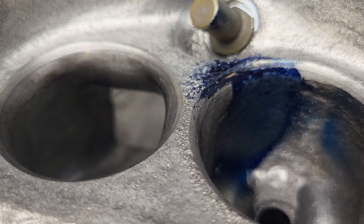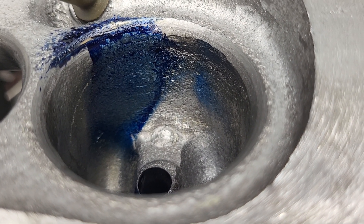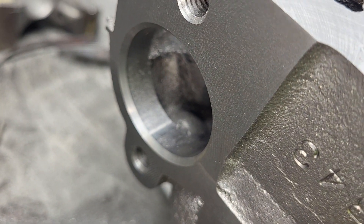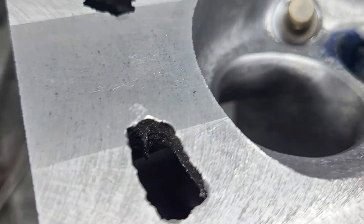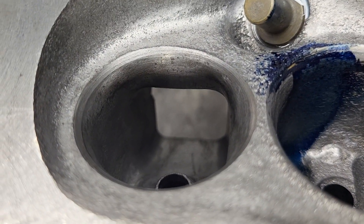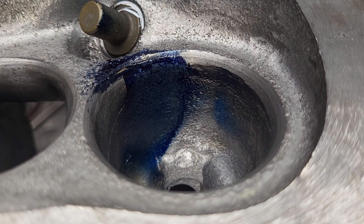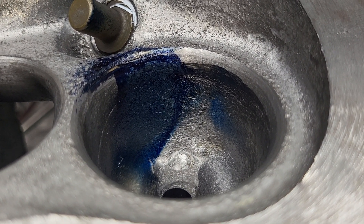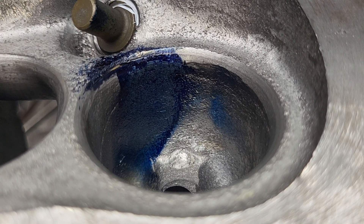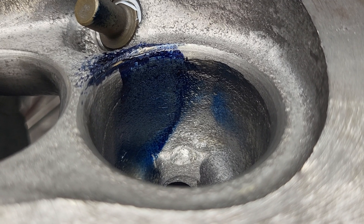There is some meat on the inside walls of the bowl, but not as much as I would like. We could take a little more off and still have it safe, but it's nowhere near where I thought it would be. The exhaust is amazingly thin — I was surprised they did it like that. Without Welch plugs in this, I can go right to that edge and measure that wall. It's a little over 100 thousandths, and it was not touched. I can show you that on the Sonic — I made sure it was reading right, because any critical job like this, it better be reading right.